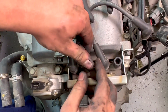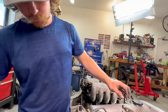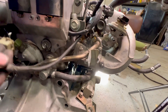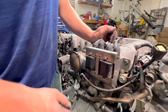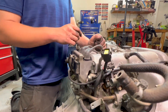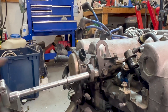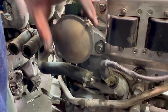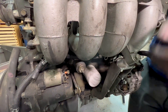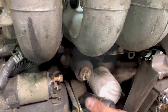The plug wire's just a little short — good enough. We'll plug in our coolant temp sensor. The coil harness goes to the car. We also need to steal the old cam angle sensor bolt because the one on our 1.8 is missing. We'll leave it loose because we'll have to put a timing light on it.